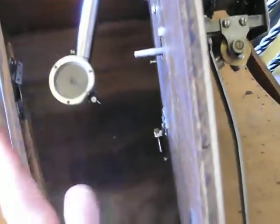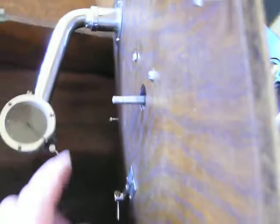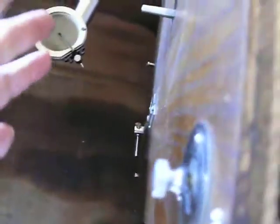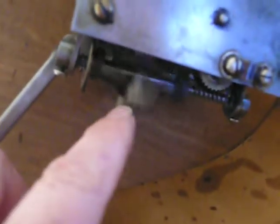But now, knowing what I know, I would not remove the motor plates that hold the motor winding gear on, and just would have removed the 6 screws that hold it in. And then what happened was this little teeny screw right in here came undone and fell inside. And so this would catch on the speed mechanism.